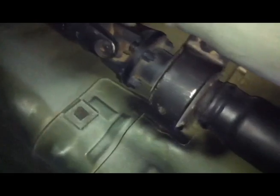So I just got the bolts loosely mounted in the cross member, and sorry guys, I'm not looking at anything here. I have to look underneath. There's a mount there that holds the drive axle on, and I just put that back in. So now what I'm going to do is just tighten up those bolts, otherwise I'm just going to forget. Tighten up those bolts, put the clutch slave cylinder back on, and then that's all I need to do really under the car until I run the exhaust, so then I can just jack it down.